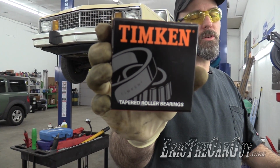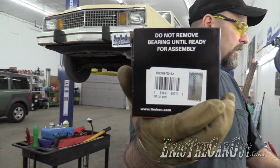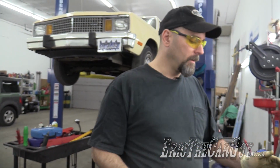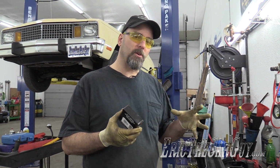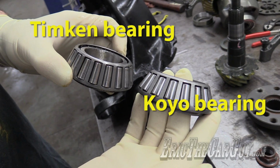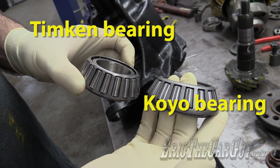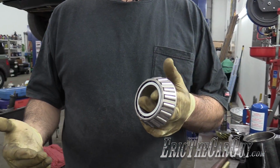Now apparently there's 2 companies that make these pinion bearings or bearings for this setup. I'll put links to these in the description, and that's Timken and Koyo. The original bearings that came in the Ford kit were Koyo bearings, and there were some subtle differences between the two. The Koyo bearings were a thicker roller, but there were less of them. These Timken bearings, it seems, they have more rollers, and they are smaller. They both perform the same function.